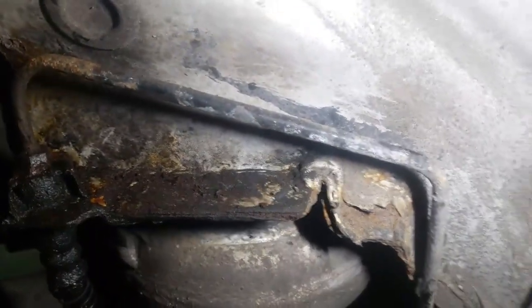So what we'll have on this one is bad brakes. Brake pipes aren't good. Mercedes don't have the best of brake pipes at the best of times. There's a bit of corrosion there. I think it's been painted before by the looks of it. And if we take her below here, that's a decent bit of line there, and it's a bit of corrosion there.